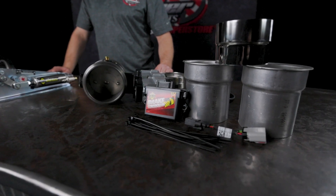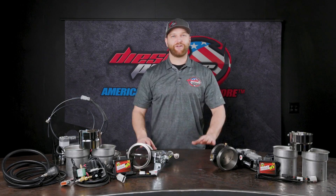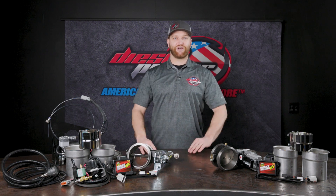Let's talk about what makes these brakes different. As far as looking at them goes, they both have a butterfly valve, they both live in the exhaust, and they're both actuated by something. This is not a jake brake, this is an exhaust brake, so it's just a valve that closes in your exhaust.